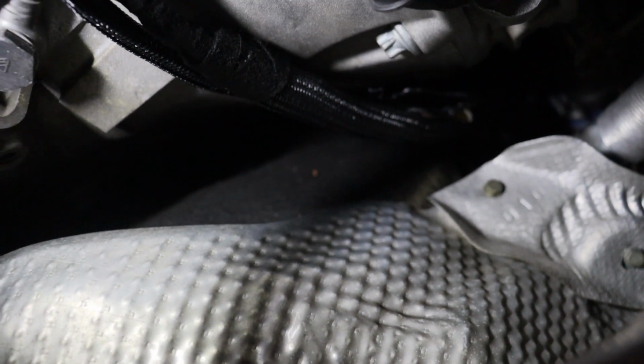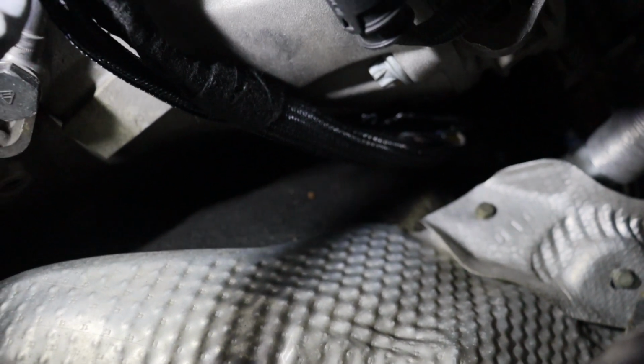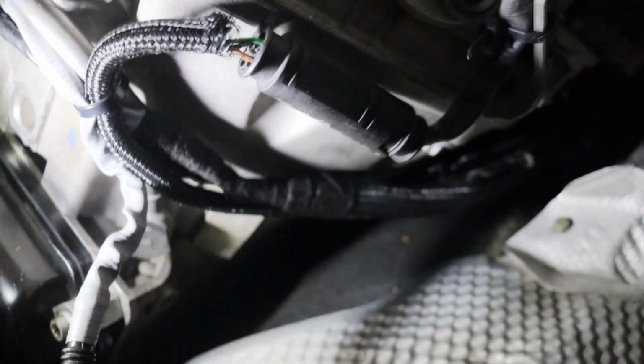I didn't re-solder those wires, those 4 butt connectors. I just basically put electric tape around each one of them to make sure they're not going to come into contact with each other. Because like I said, we are going to disable these anyways, so I just didn't feel like reheating solder on all of those in close quarters right now, and I didn't have any new butt connectors to make it easy on myself. So yeah, just doing what we can for the time being, making sure it's at least safe and tucked away.